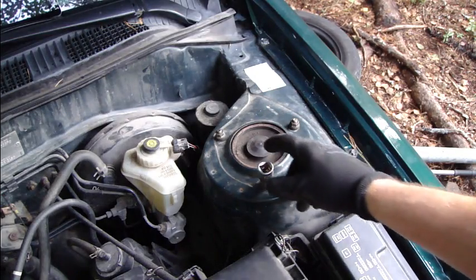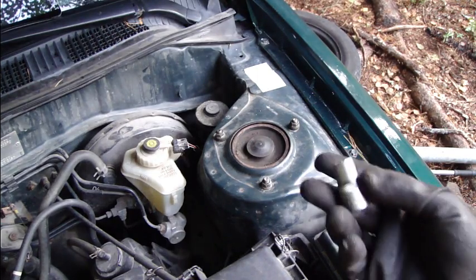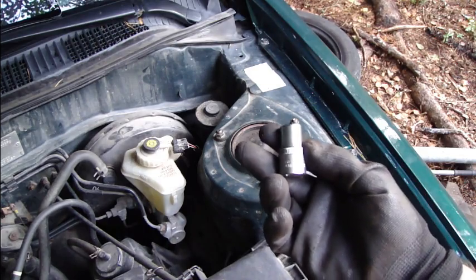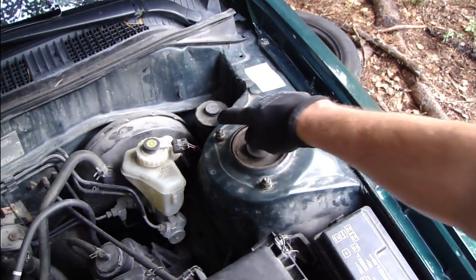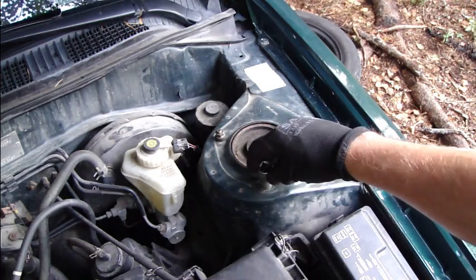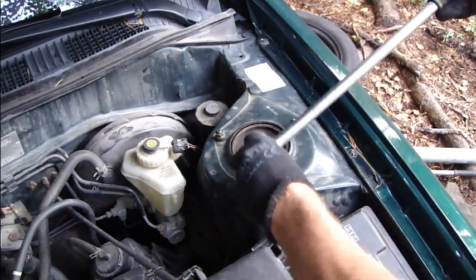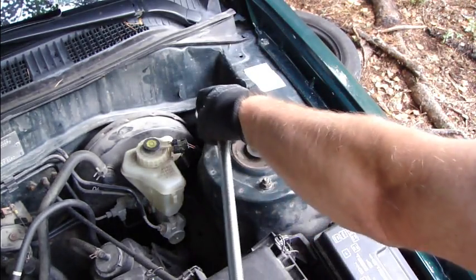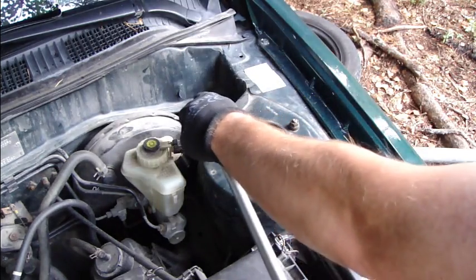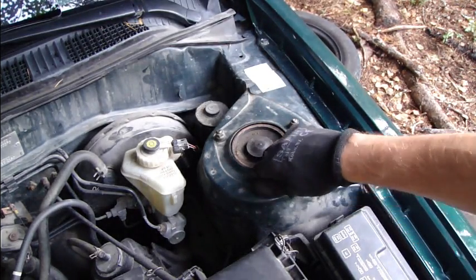Okay, and now I have opened this front motor area bonnet, and then we need socket what size is 12 mm, and we install that socket in to these 3 nuts. And there is first one, and then I move and it opens easily. Second, and then third one.